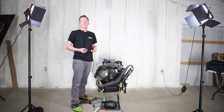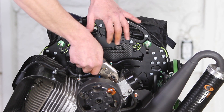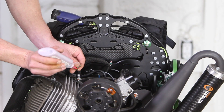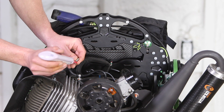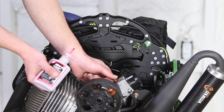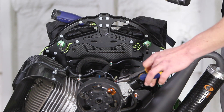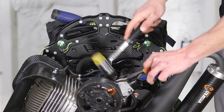So now we need to remove the existing fuel nipple and replace it with the 90 degree fuel nipple. It simply removes that easily. Now add some Loctite. Align the 90 degree nipple roughly center line of the carburetor. Grab a pair of pliers and your favorite hammer and apply a little bit of love.